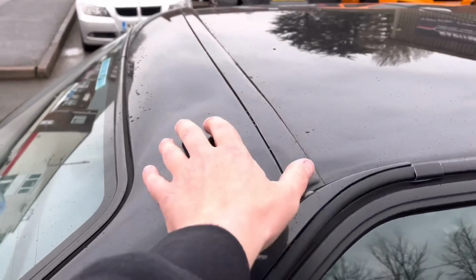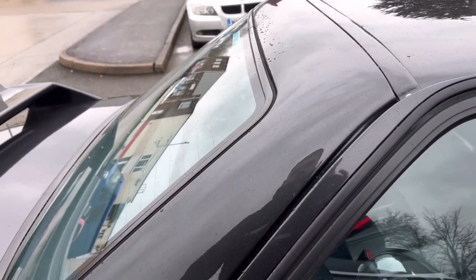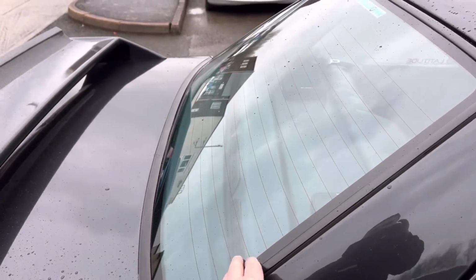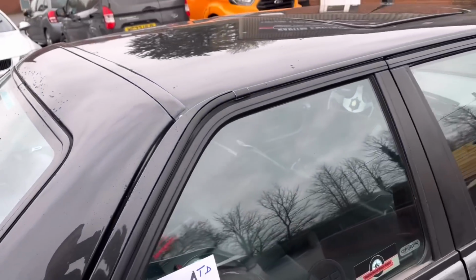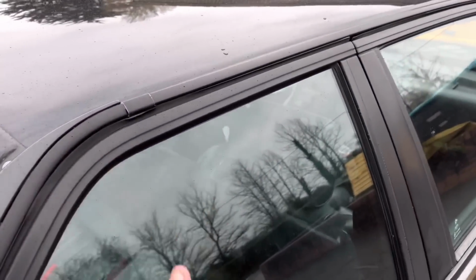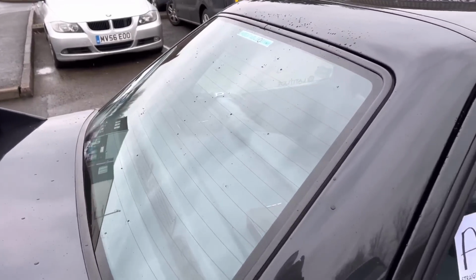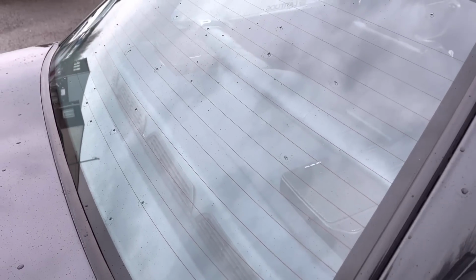See on this M3 here where all the back's different, this is all just an add-on onto the standard E30 chassis. So this is all just an extension really with a bonded in rear window. Ordered all the windows for ours yesterday in plastic, but thermo formed and hardened, so you've got all the original curvatures on the glass and what have you. And you see the rear window's different on the M3 because you've got the black around the edge, so this is bonded in as opposed to just sealed in.